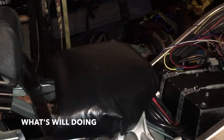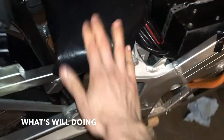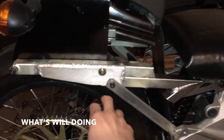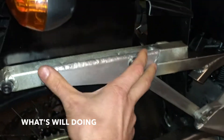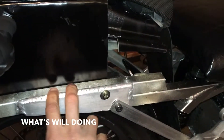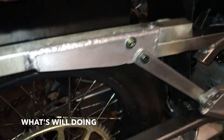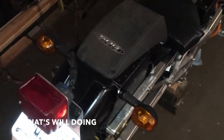We're making a bunch of progress. The last video clip was talking about the subframe and the seat — I got the seat done. It doesn't look pretty, but I'm not the best upholsterer. It's all mounted and covered. The rear subframe is mounted and done at this point. I added a large gusset here to strengthen this back part because the weight of the rear rider is going to be sitting here, pushing down beyond this attach point. I didn't want to rely on just this square tubing. It's a piece of aluminum that's been bent — actually a couple pieces, then riveted a cross plate on top. The seat is on top there.